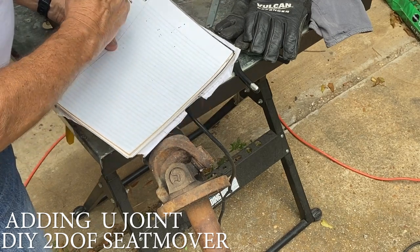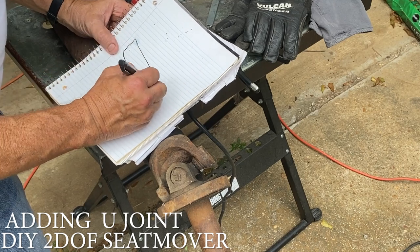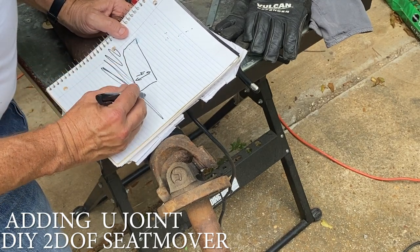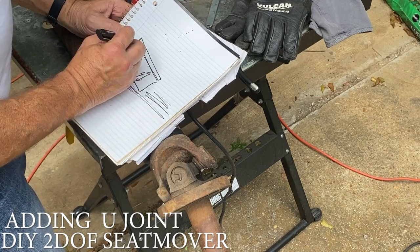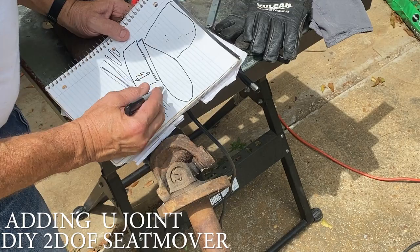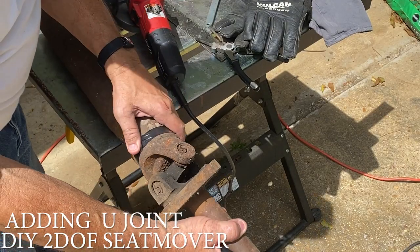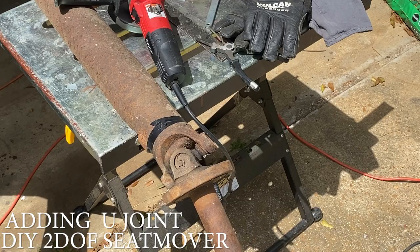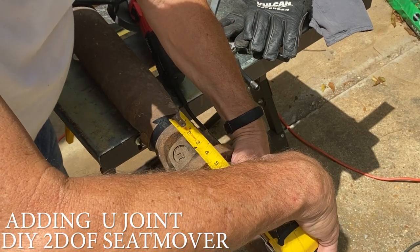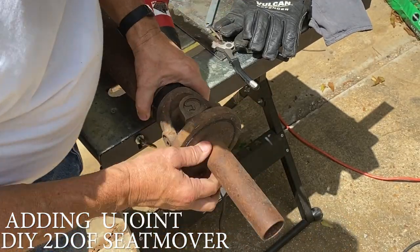Just trying to keep the dimensions the same. The frame rails right now are four inches — that's from the concrete, or wherever, the carpet or whatever, to the bottom of where the seat that we just took off is. So we got about four inches. We could go up a little bit, but I don't want to go too far. I put a piece of tape here just so I can guide myself. If we measure that cut, we got about four inches right to the edge of this piece of steel here.